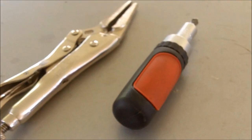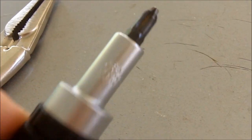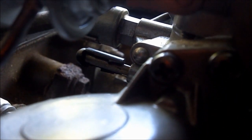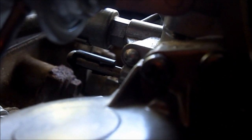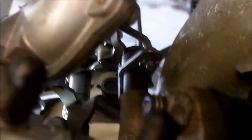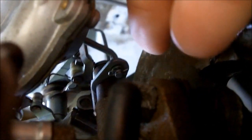So let's get started. The only tools you're going to need for this is a stubby screwdriver with Phillips and one of these. Now what you want to do is loosen up those two screws, take those off, and it will unscrew the secondary to the carb. And then there's a little clip on the bottom of the arm down here that you want to get out without losing, and then you can slide the arm out.